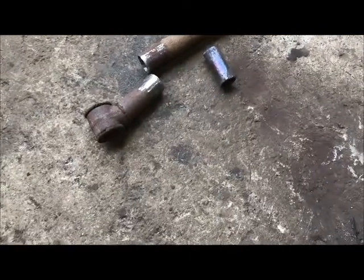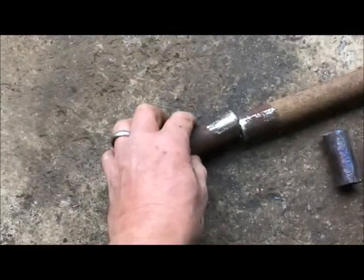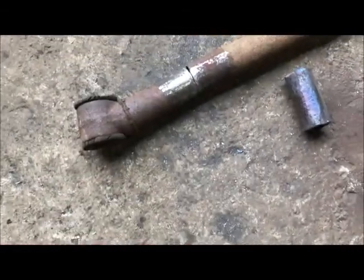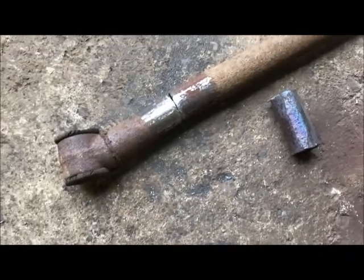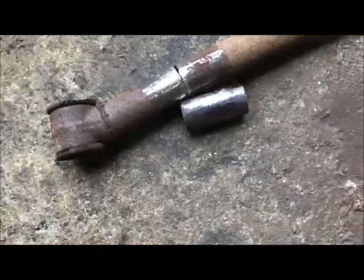All right, so in the middle of narrowing the Panhard bar, I figured like 2 inches, take 2 inches out. So I actually took out like 2 1/8 and beveled the edges. You don't want to just butt this stuff together and weld it. You want to put a bevel on them. You also just don't want to weld it together like that. So you need a slug, a piece of metal to put inside each side to stabilize it and weld it all together. So it's Sunday.